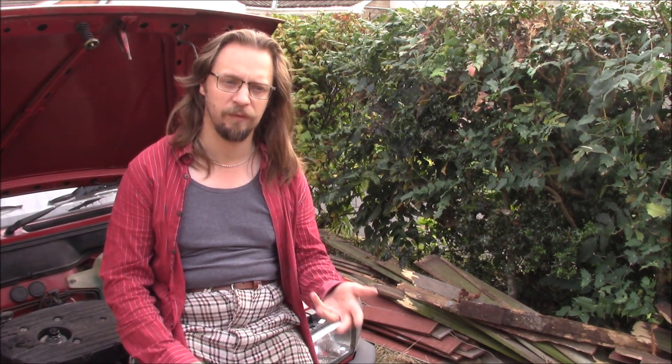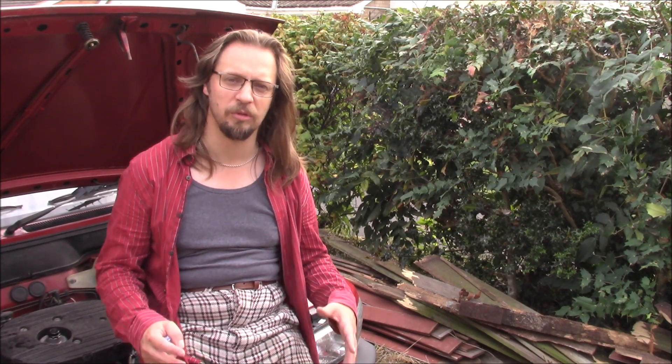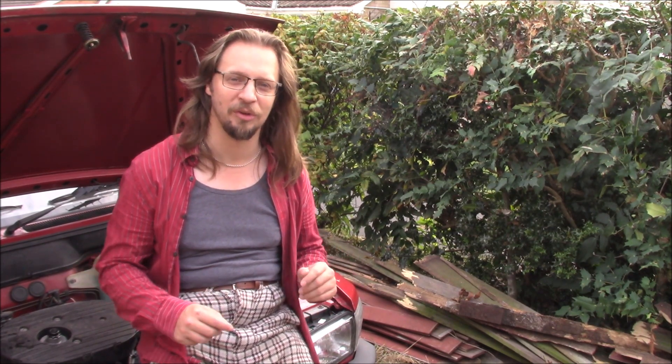I'm also trusting that it hasn't been used before, that it is new. It did look new, and the box it was in looked like new old stock — an item that's been on the shelf a long time and just hasn't sold, so it's effectively new but it's old. I'm just going to have to drive around this one for now. I'll leave the fan switch plugged in. If I start getting a repeat of the overheating problem, I'll investigate further. When I'm actually driving the car, the fan is coming on and off as it should. The temperature is staying nice and stable — it's not getting hot in traffic. It just seemed to be when I got home, had the car sat at idle and got the camera out to show you what had been done, that the problem surfaced. So we'll just have to see how that one progresses.